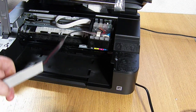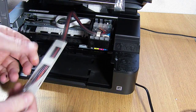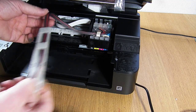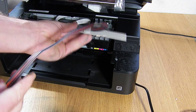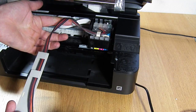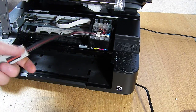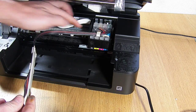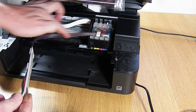Part way down the incline is your grey arm. You need to make sure that there's a nice straight loop coming off the ink cartridge and there are no twists or turns. That would be no good because twists and kinks are going to cause all sorts of problems. So you just need to take them all out and get a nice loop shape like this.